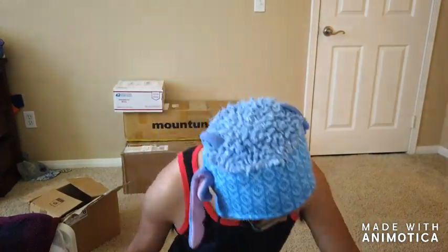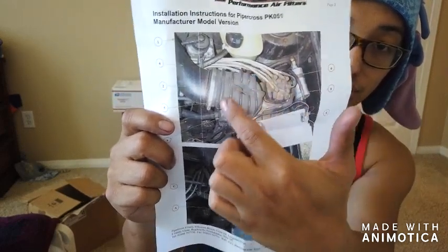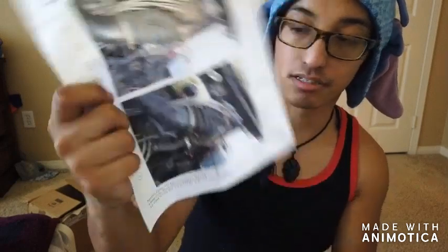So, one of the issues with that intake system is you have your air box, and the little fuel mixture plates on top of it, which is a good system. I mean, the one I have works pretty well. So yeah, it looks like this. You have your injectors, fuel pressure regulator. This is where the air mixture is, and it sits on top of your air box. The problem with that is the only performance option you have is to put in a panel filter or cheese box the bottom of it. I've also seen on some Volvos they have like an actual cone for it, but those are really hard to find. So that's where this comes in.